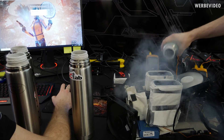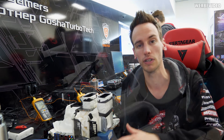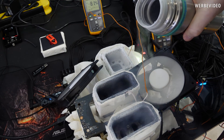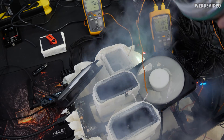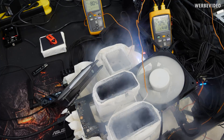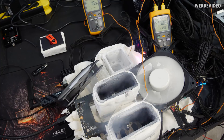It's already 6 PM and we tried this for about four to six hours. It went nicely at the beginning. We started with the CPU, pushed the 28-core to 5.6GHz, tried 5.7 which got halfway through the benchmark but to stabilize it we'd need to go to minus 100 to minus 105 degrees Celsius — risking cracking the paste and losing contact to the chip and IHS. We didn't want to risk that for 3D benching, so we stayed safe at 5.6GHz with memory at 3800. Then we started clocking up the cards — running 2500 to 2600 in single GPU individually, but SLI is much more complicated and the resulting clock is always lower.